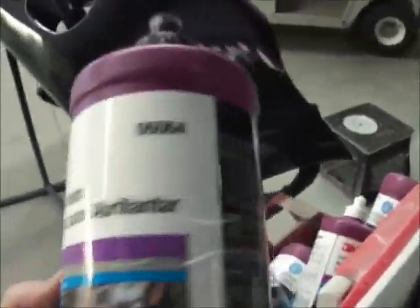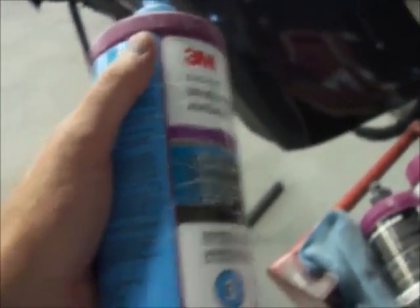And then I'll spray some cleaner down, wipe it all down with one of these type of cloths. And then I will go to this polish with the black foam pad. This step, after the first few steps I've done, is pretty easy. You just do a nice polish job and that's it. And then without wiping anything off, I switch to the blue foam pad, and I just skim this out over the whole thing. It just breaks up all the smudges, and with a nice clean microfiber cloth, just wipe it all down and it should come out very nice, swirl free. It'll look really good. And those are the steps I'll be taking Monday, and that car should look nice.